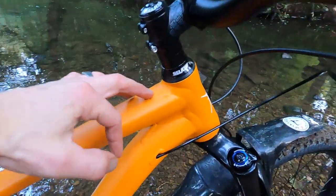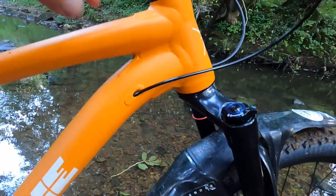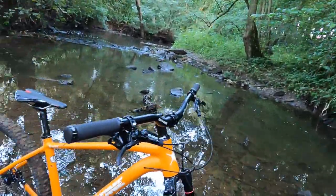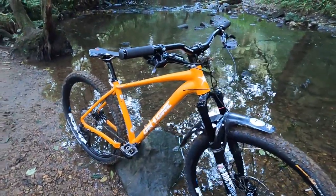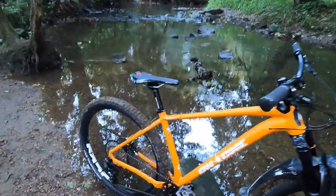You've got neat gussets up here on the head tube — on this short 120mm head tube — another gusset to add strength, and a third one underneath. It's a 130mm fork, but this is a bike that can take a reasonable amount of hammer. Not the lightest alloy frame — it's a two kilo frame — but a really tough, accurate, and dependable alloy frame.